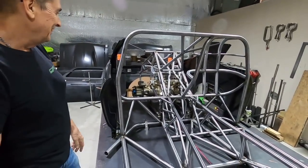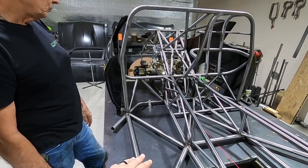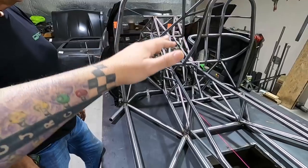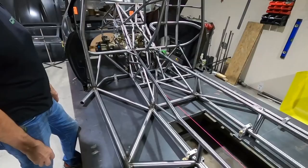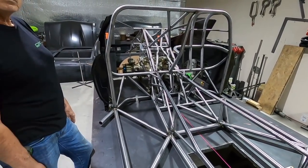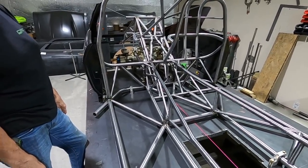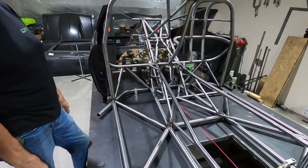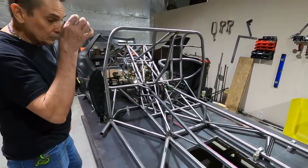This chassis is a 25.2. A 25.1 would be a pretty similar chassis except it doesn't have an X in the roof, and this bar would be one inch instead of inch and a quarter. This chassis is suited for a heavier car — a nitrous car would be 2,200 to 2,400 pounds, around 2,450 depending on class, but this blower car is going to be up to 2,800 or 2,850 depending on class. So you want the 25.2 with a little heavier tubing.